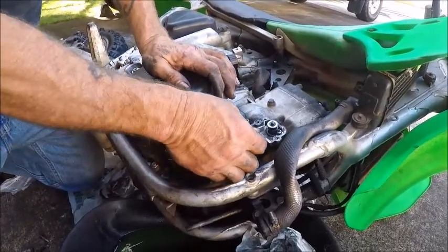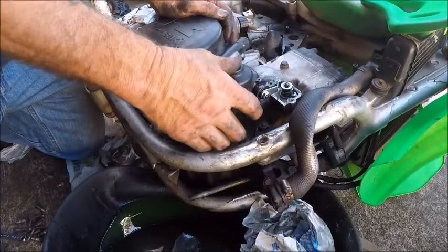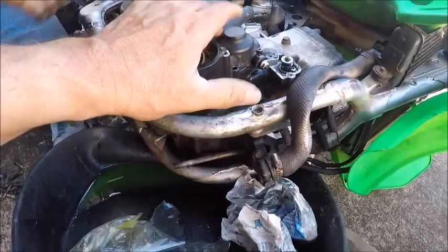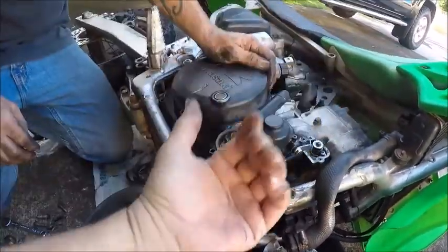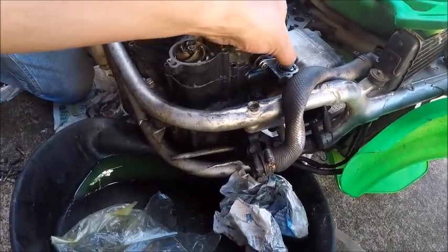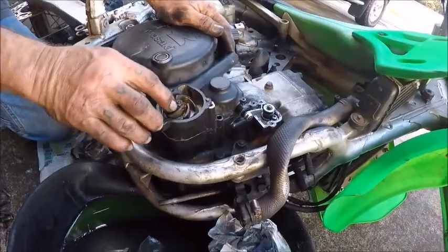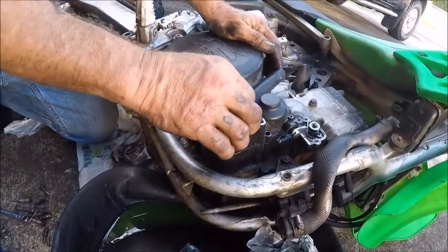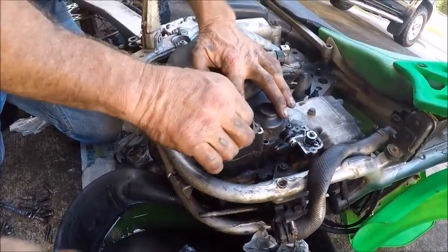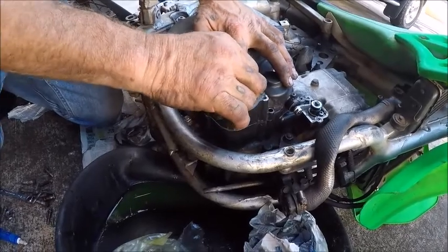Yeah, just put them on and down the back side. Tighten this bolt. So the flap down here, your flap pad inside here, goes down that way, underneath that spring loaded. That's what's gonna pull this in and out once we get this all tightened up. We're gonna put some Loctite on there. Down here we're gonna put a little bit of Loctite as well. We got a little crack in this gasket, so I'm gonna put a little silicone. We should be good to go.